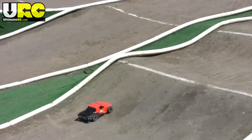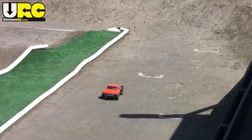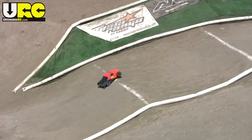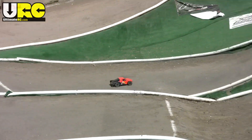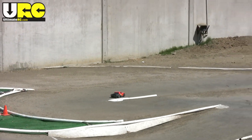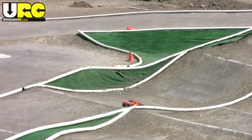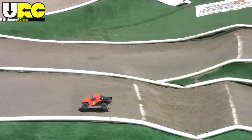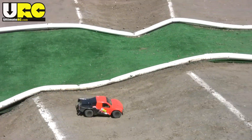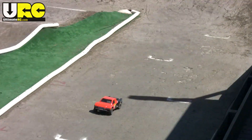What is a big help here is that stiffer spring included in the servo saver portion of it. Also, the use of aluminum for the bell cranks removes that flexible part which I pointed out in my original review of this HPI Blitz ESE Pro kit. So now, where you turn the servo, that's where the tires are going to point. Everything else is up to tire selection and setup. Thanks for watching, and if you have any questions or comments be sure to post them up in the short course forum at UltimateRC.com.